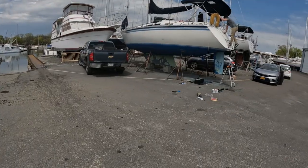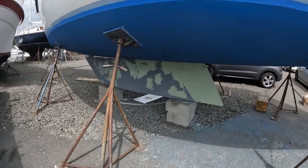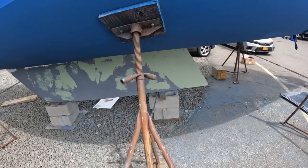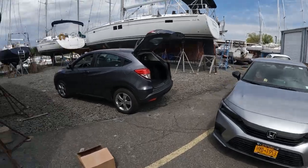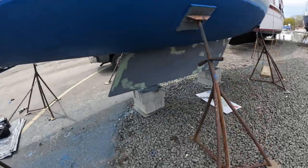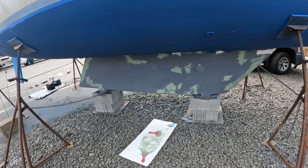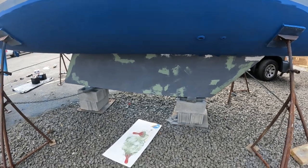My hands are sticky but we finished the fairing — didn't need as much as I thought, so that worked out rather well. Did a little bit of work on the rudder too; the back had a lot of pitting, all filled down. The rest was just pitting — 5200, still a little leaky but we'll keep pushing it in. Now he's just got to go ahead and sand this probably later this afternoon. This side was much better — didn't need much at all. All in all, half that fairing compound was used, so you get an idea how far it actually stretches. Could have done probably the entire keel with a skim coat.